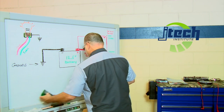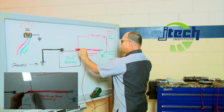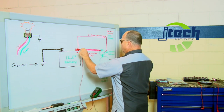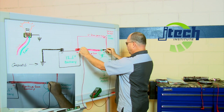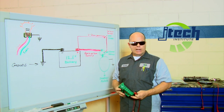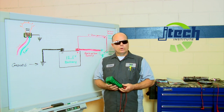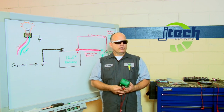We would then move over to the positive side. If any of you guys have ever noticed along the battery cables any green fuzzy looking film or buildup of any sort, that is called corrosion. That corrosion always builds some sort of resistance within a circuit — high resistance is not good. You want to make sure you have continuous power flow all the way across the board. On the positive side, we would do the same thing, putting our leads the same as on the negative side. Anything higher than 500 millivolts is not good. The new industry standard for voltage drop is 300 millivolts, so anything higher than 300 would be considered excessive. In the starting circuit, I've always used 500 millivolts as the acceptable number — anything higher than that would be considered excessive.